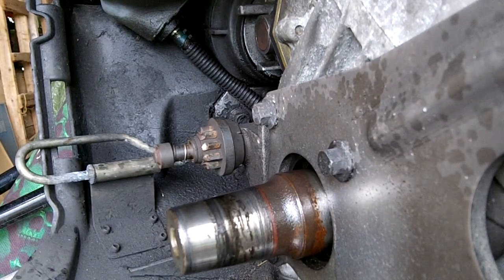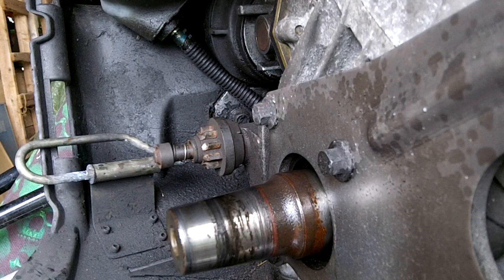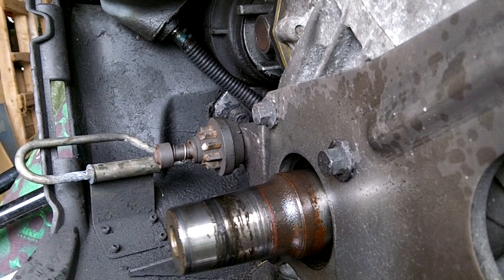In this repair video we're going to change out the pinion gear on a 2011 Arctic Cat F8. All 2007 to 2011 electric starts are exactly the same. Arctic Cat sells what it calls an update kit, so it's basically a repair kit that fits all these models. So if you're having electric start issues, this video covers the fix.